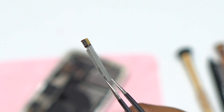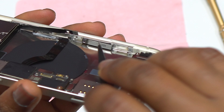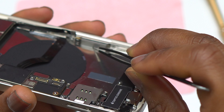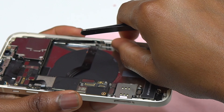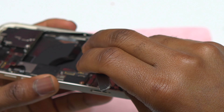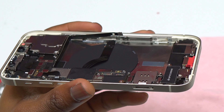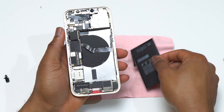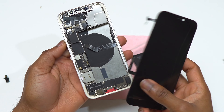The 5G antenna is attached by double-sided tape on the back. Heat the outside of the body directly where the 5G antenna is located for 10 seconds, then apply a little bit of pressure at the bottom portion of the 5G antenna for it to come out of the slot. If it doesn't work, heat again for 10 seconds and apply pressure again at the bottom portion where there is no flex cable connection.